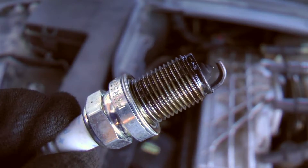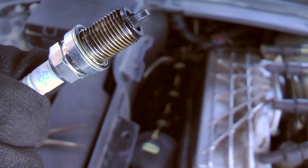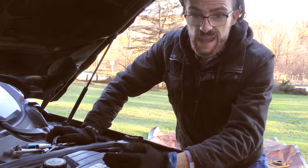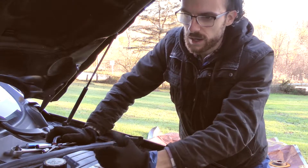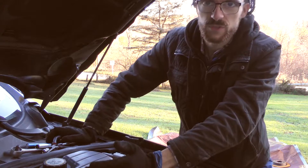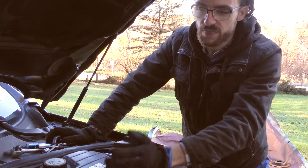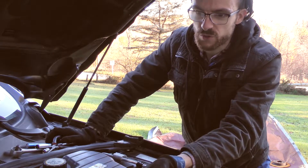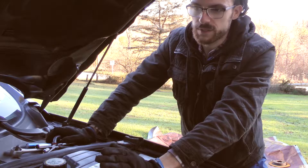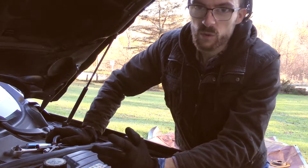Okay, that was all number one. It looks a little oily — maybe an indication of what would be going on. It doesn't smell like fuel or anything like that, so that's good. But definitely worn out and gross. I really want to point something out: these European cars and these high-performance V8s run hot and hard and fast — the spark plugs are going to go out faster than, like, my Acura TL V6, which is just a cruiser or a chill touring luxury car. This is performance touring luxury sport with a supercharger. So the spark plugs need to be changed probably more often than 100,000 miles — you're looking at around 60,000 for high-performance cars. There's no getting around that. You need to take care of your car. That's why they look so charred and black.